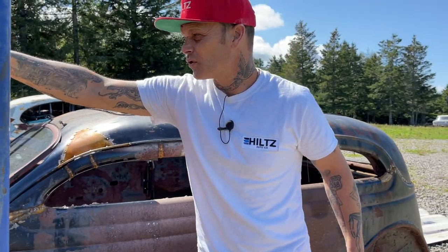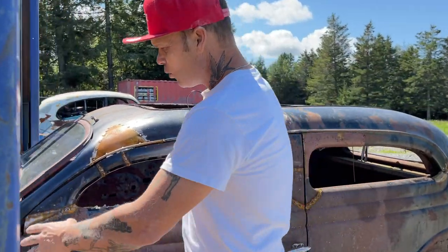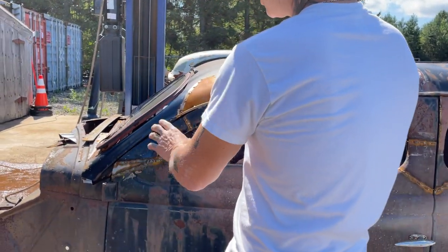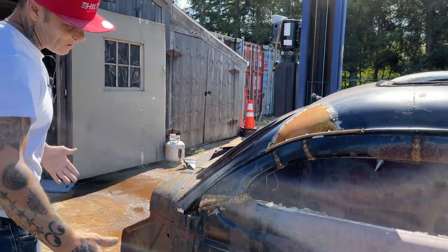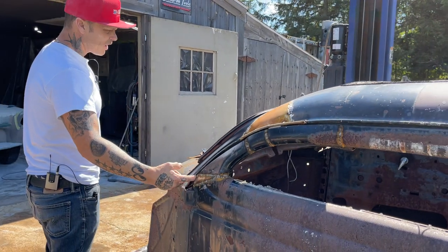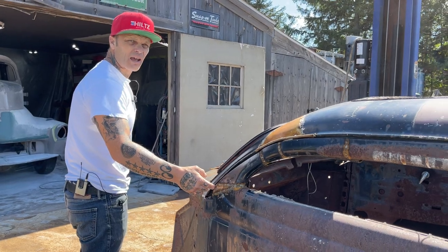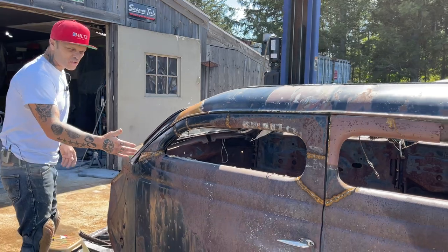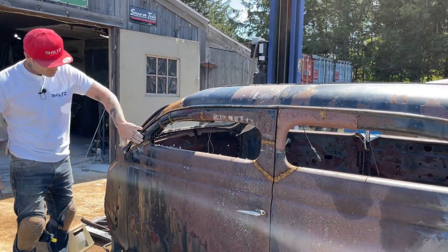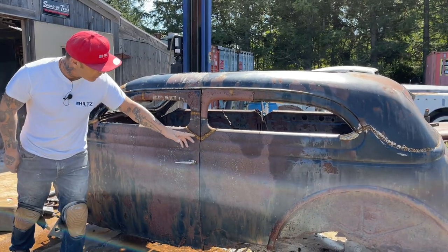I did it on the door of the truck. I made a lip. You take some off or put some on, one or the other. The window post has come out further because we chopped it without cutting it in half. I hadn't seen one done this way before, so I wanted to try it, and it seemed to work out. There was a guy said that I was a hack. I hacked it off, right, I did. Hacked it off with the hacksaw. Only way I know how to do it. If I want to do it slow, you can do it slow. Yes, you can. Or you can hack it off, and that's what I did. You can see how it's welded back up. We're fine. We grind that off.